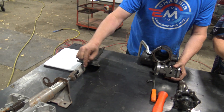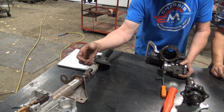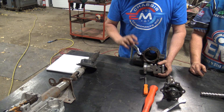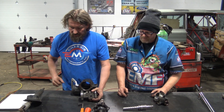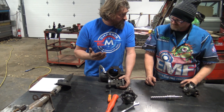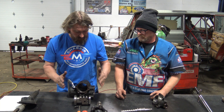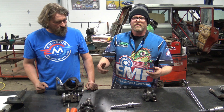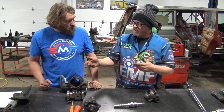What also accents that is the intermediate shaft bushings — that's why we put these in — because those bushings allow the shaft to go back and forth. So as you're holding on to your steering wheel and that little torsion rod's going back and forth, the intermediate shaft is also hammering it. We'll do a demonstration in a bit, but these help reduce your death wobble chances hugely. Like I said, this is what we were talking about when we were doing our death wobble video. What we think is: if you had a magic way of shutting the vehicle off mid-death wobble, we're pretty sure we could get it to stop.